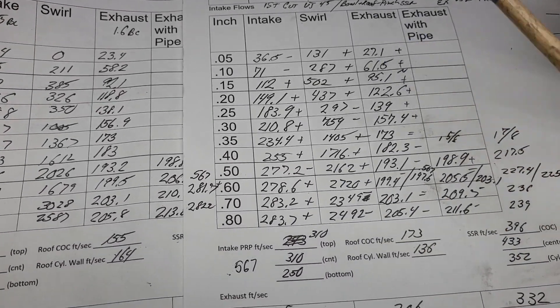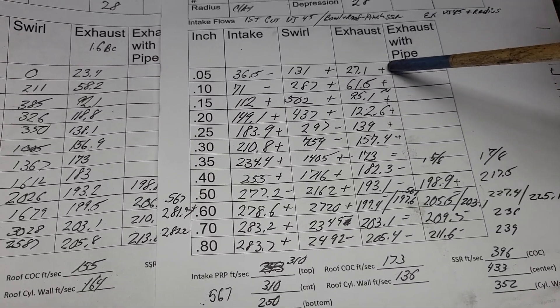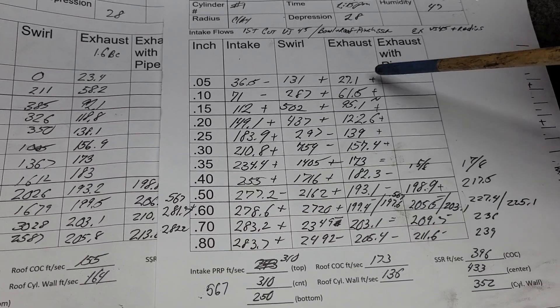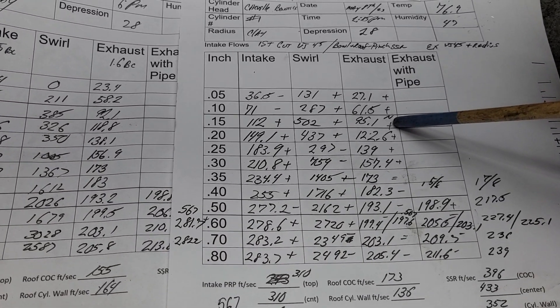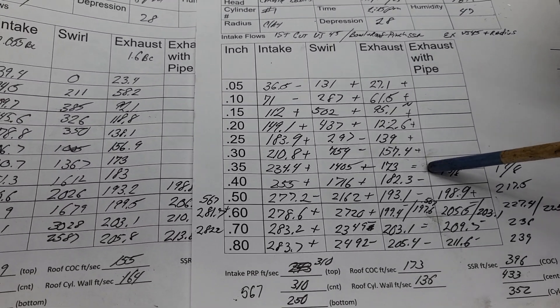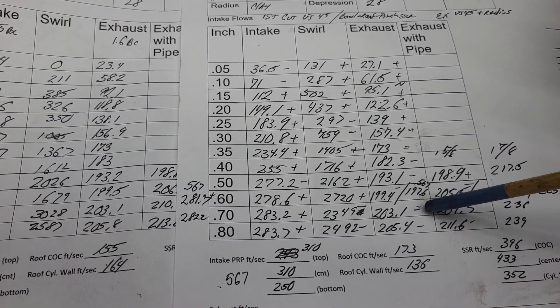Let's take a quick look at our exhaust. Remember, the exhaust had very little work — just reducing the width of the seat, which makes a nice difference, and that radius. So we got plus, plus overall. We had a little bit of noise but still came in as a plus. Working through the pluses and minuses, it didn't quite top out as good.